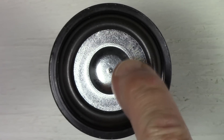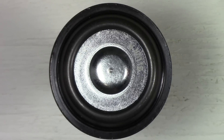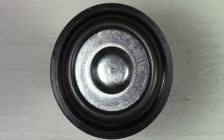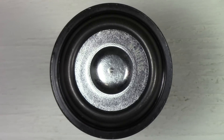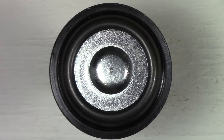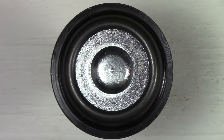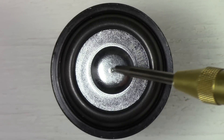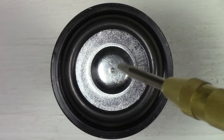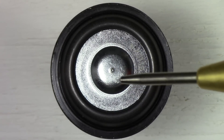I've got a hole in the center of that bottom cap on that ball joint. I wanted to stress that you can get these ball joints with the Zerk grease fitting already on the bottom, but they're not cheap — the cheapest I saw were $36 a piece, where the ball joint I'm using here was $14 each. The Zerk fittings are very economical — a couple of dollars for a few at your local auto shop. I can see my punch hole there on the center. I'm going to start with a very thin drill bit to punch a hole through the center to the actual ball, then measure how deep it is so I don't go too deep and damage the ball.